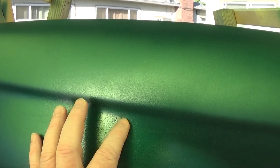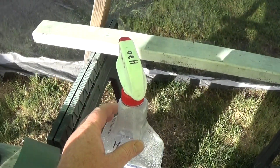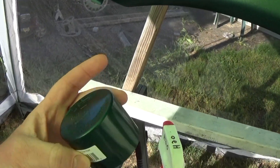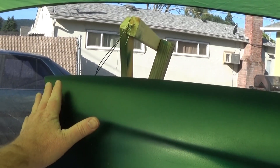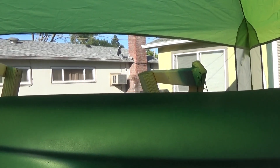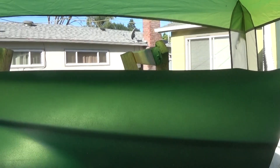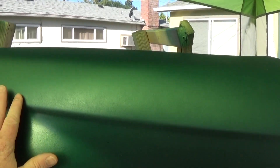On the front I'll have a corrosion primer, then a sandable primer, then wet sand with a thousand grit and some water to get it smooth. Then I'll put on the color — I want to use this, it's called a true color match, that's just what they call it. I'll spray that, then wet sand it and keep going over it until I'm happy with the look.